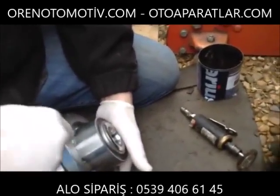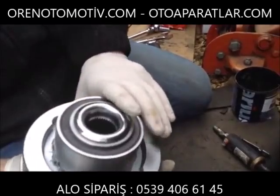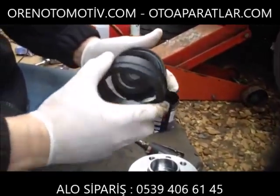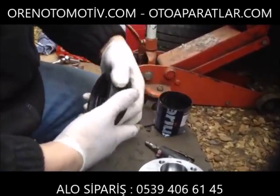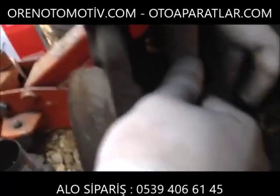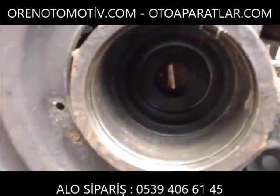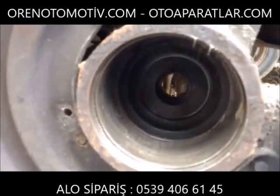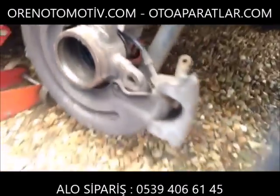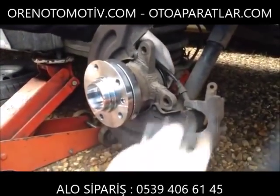These bearing pushing plates fit nicely on the clip and they're snug and it pushes the bearing home exactly as it should be. You then take the two black seats, you can see that they've been a little bit dirty, and they fit nice and neatly and snugly on the side. You can see they fit snugly all the way to the back of the bearing face where it almost sits home, so that way when you pull it in you can see what's going on. Mount the bearing up to it, give it a tap so it's somewhere near home.